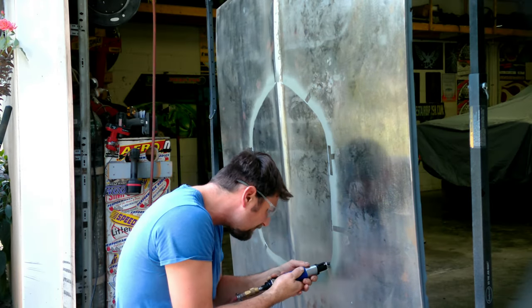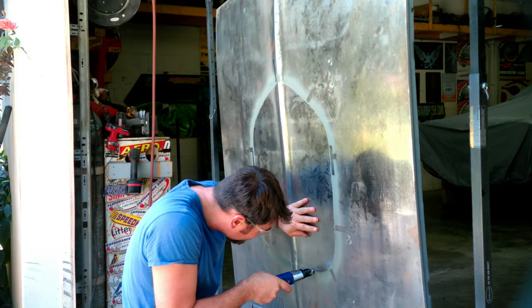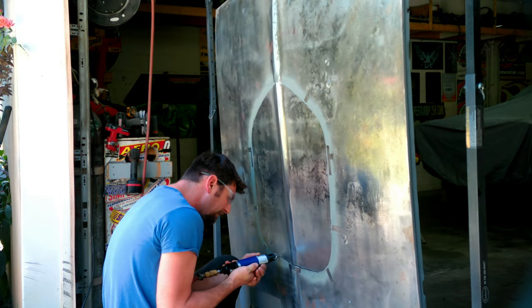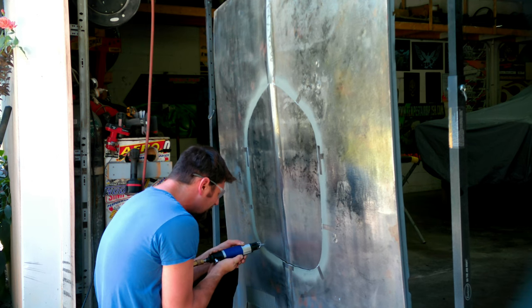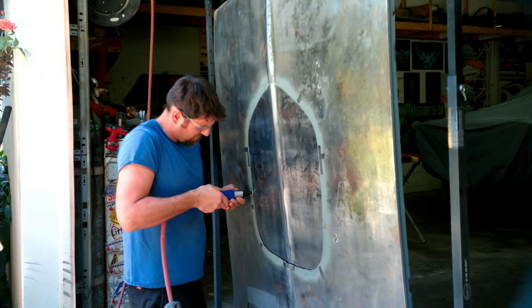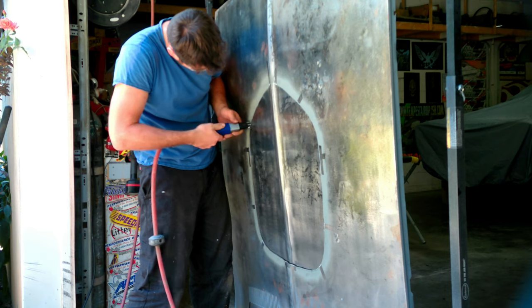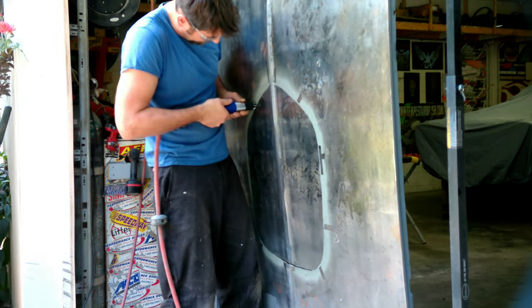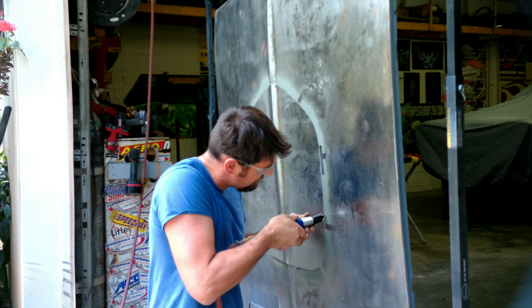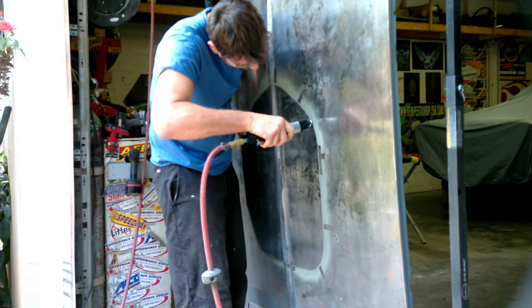This is the big moment. Now that the inner structure is all cut out and there's nothing in our way, we have our shaker numbers all verified. We're going to go ahead and cut the outer skin out for the shaker. This is cutting it out on the inside of the hood where it's going to recess under the shaker trim ring, so it's going to be smaller than our shaker trim ring and wooden support piece. You want to try to keep the heat out of this because there is no backing structure behind it. The pneumatic metal saw is the easiest way to turn it and keep the heat down. Make sure you cut on the inside of the line and then take a surface prep disc or flap disc and grind out to the outside. It's better to go that route than to cut too much, because putting it back would be a lot harder. Just cut the line — take your time.